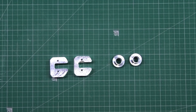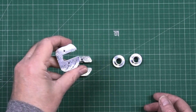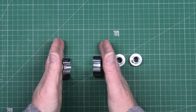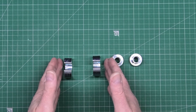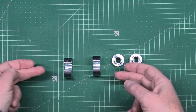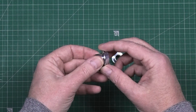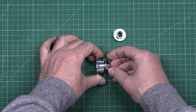They've finally arrived - the last bits I need, which are the torque arms - or mounting points. The wheel on the back has dropouts that are that wide because the motor hasn't got enough to actually overlap the dropouts so you can't get it in. These are inserts that you put on the inside and they act as torque arms - that goes that side, that goes outside. And these are extended nuts that go in there, which bolt into the axle.